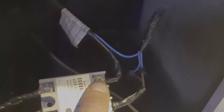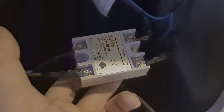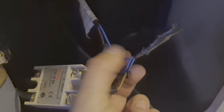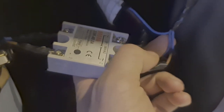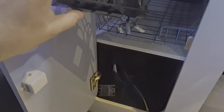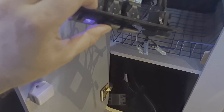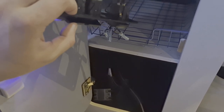On the 240 volt side we've got two lives that go off to the water heaters in the water container, and on the other side we've got the feed that comes from the inverter going through a 13 amp plug. The neutrals are crimped into a bullet connector, but when this goes in the proper enclosure they'll go into proper electrical connectors. I've already got the isolator switch on — I'm going to switch on the inverter switch first, and then this switch here will activate the relay and give us the power. You should just be able to see the light coming on down there — and that is activating the relay and putting the power into the budget water heaters. Switch it on and you should be able to see the lights coming on them.